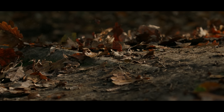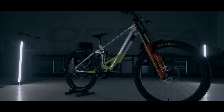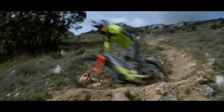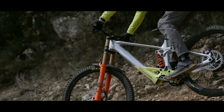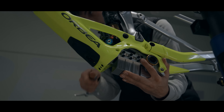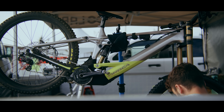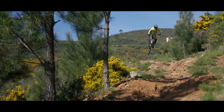Pushing the bike beyond its limits in downhill allowed us to test how weight distribution in the BB area really matters — small adjustments can have profound impact on track. We had the motor dummy, which we could load with weight underneath — up to 3.8 kilos — but of course, almost four kilos was way too much. Feedback from Martin and Giles meant we were able to fine-tune motor and battery placement and its effect on the bike's handling in real-time on a variety of tracks.